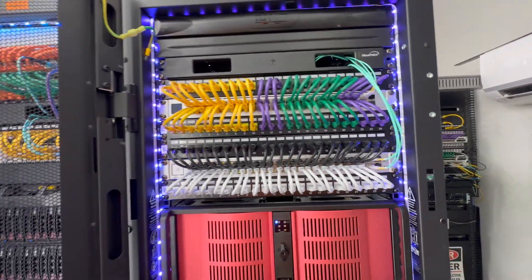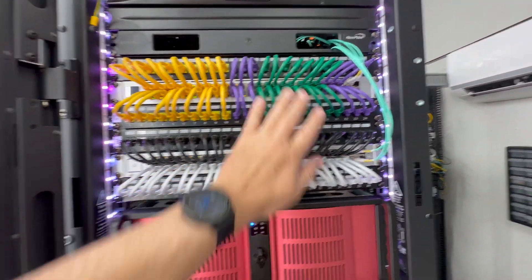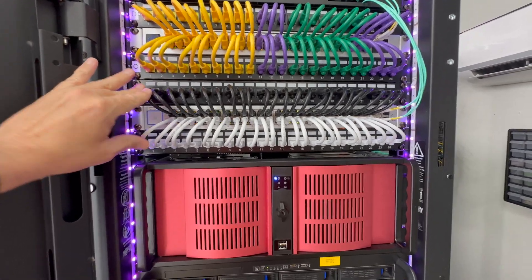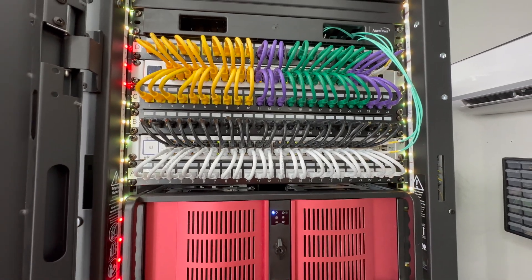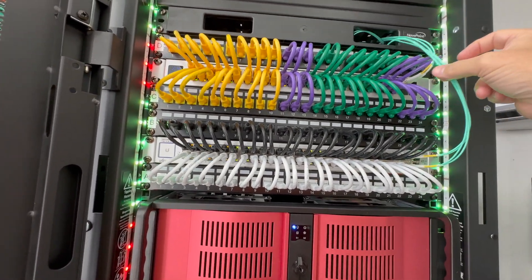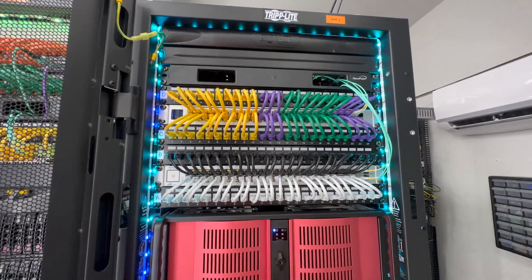Looking at the next rack — same thing. Yellow keystones on yellow cables are the IPMI console networks. These are some internal VPN networks. All the servers have a primary and secondary network connection — black with black keystone, white with white keystone. It does make for a pretty neat setup. I think this needs to be cleaned up a little, maybe with an attachment to the side. But overall for a server rack on the front side, it gives it a neat appearance and it does look cool, which I'm perfectly fine with.